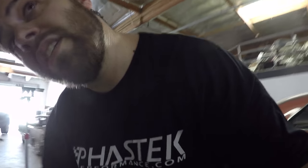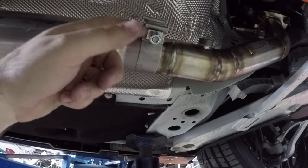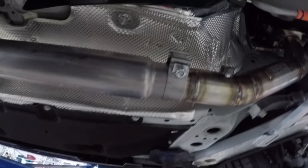So, this is the most important step. You've seen us install everything. There are some nightmare pieces. Some of the bolts you're going to have to get tricky. We got really smart over here. So this bolt, we could not get the nut and the lock washer and everything on. So what we actually did is we put the adapter and the nut, tightened it, used a pair of pliers, gripped it, and then undid it all, and then put the lock washer on so it was easier to put on. Tech point, be smarter than the brackets.